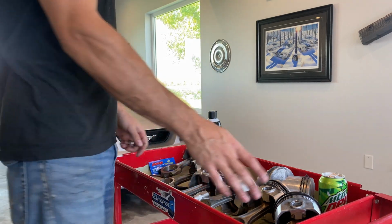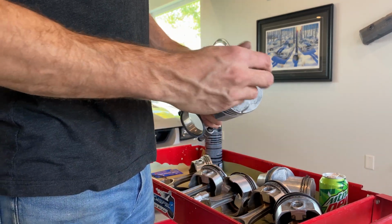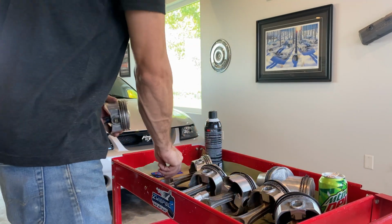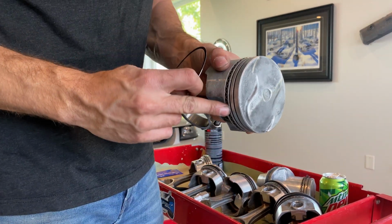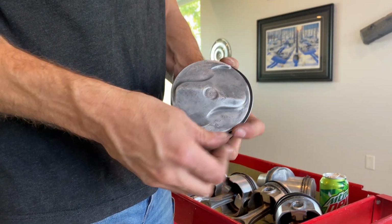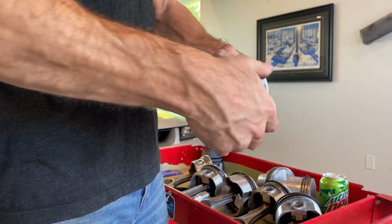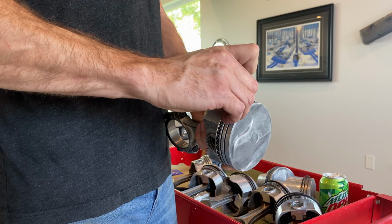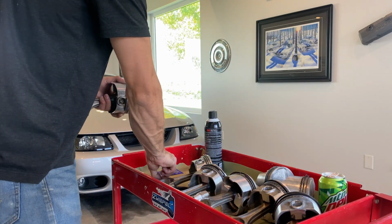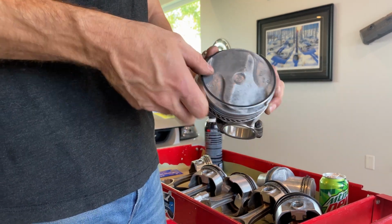All right, guys, I got 7 of them done. I wanted to show you guys how easy it is. Oil rings are the easiest. You literally, it won't break. Just try not to hit the edges on the sides, nick up the sides. Put the middle in first, find where it stops, make sure you don't line up. Do the same thing with this one, go down one groove at a time. The oil ones are the easiest. Follow it around. Just like that. On the top. And this will pinch the oil, so my end's there and there, so I'm gonna put this one over here.